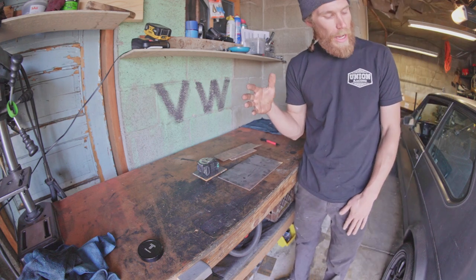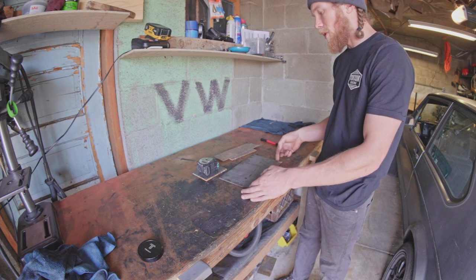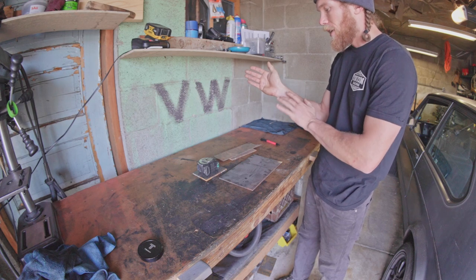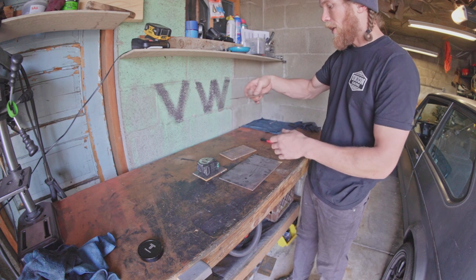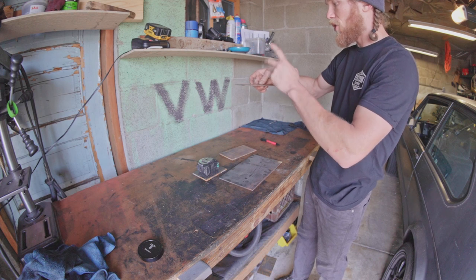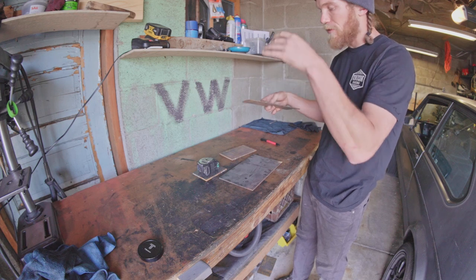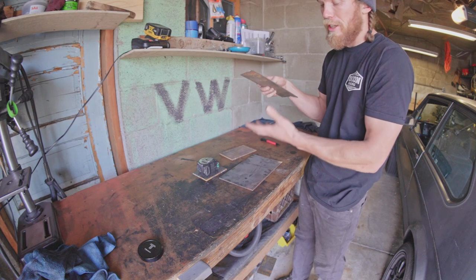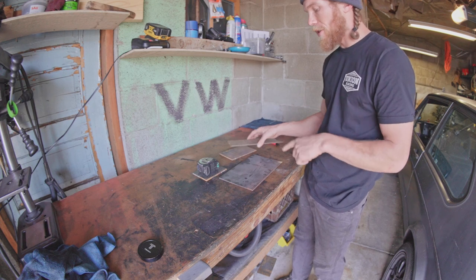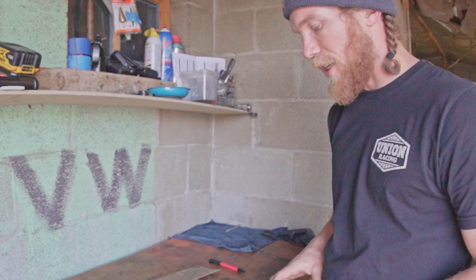The rear gets a little weirder — I don't think there's as nice of a non-permanent solution available. It's possible you could fit a tube in there and bolt the shock to that, but I think it might be too wobbly. So ultimately it might be easiest to just weld the plate to the inside of the fender. If I'm raising the front by two inches, I'm going to raise the rear by four inches, since it's already at its tallest ride height. I'd love to compress the coilovers' height adjustment a bit, so I might make the front three inches tall so I'm less at the extent of my coilover adjustment. Anyways, we're still going to proceed with this idea.